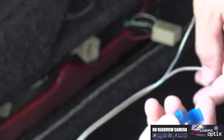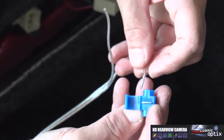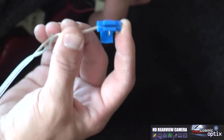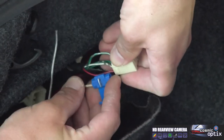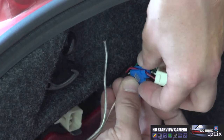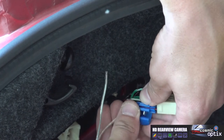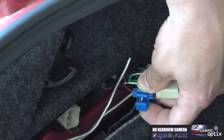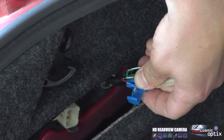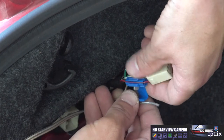So here's our splice. So you have one end which has a stopper on it. That's what we're going to actually stick this wire into. Make sure you feed it all the way up to the end. And now what you're going to be able to do is slip it right over your reverse lamp wire. That's locked in. Now we're going to go ahead and get this ready to close, and using our channel locks, we're going to go ahead and lock it down. Now these are a little bit finicky, so you got to make sure you got everything in place before you crimp it down. Otherwise, you're going to have to take it all off and start over again.